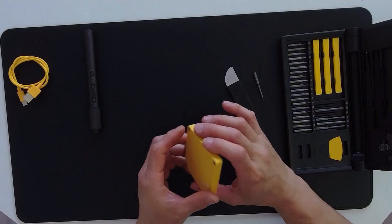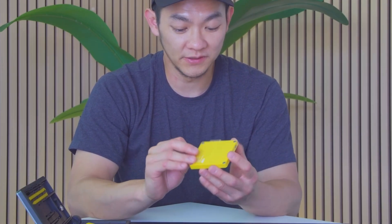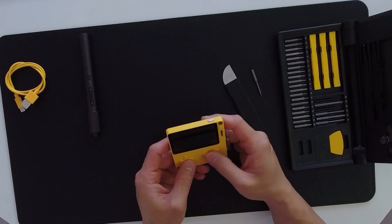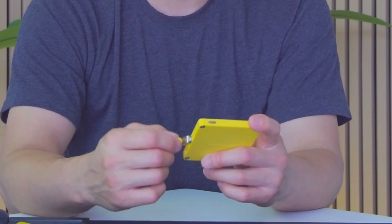Let's take a second to talk about overall fit and finish. Whenever there's thin wall plastic like this — about a millimeter thick — I like to see how rigid the entire structure is and if it makes any noises between parts. Squeezing the edge, there's actually a little bit of play where the thin wall on the top edge of the front cover flexes slightly. It's less noticeable on the other sides but most prominent on the top. In terms of feel, the recessed features are pretty nice with no noticeable sharp edge. There's no haptic feedback — they've replaced haptics with acoustic feedback, which you'd expect from Teenage Engineering, known for designing music synthesizers. This definitely has that DNA built into it.